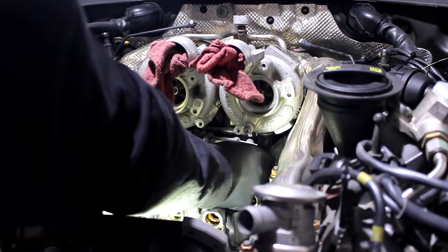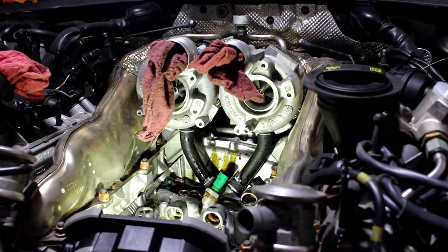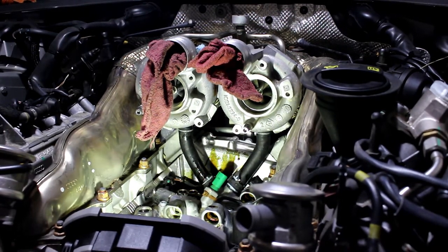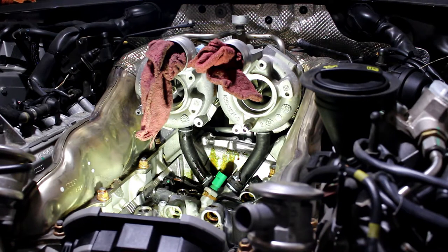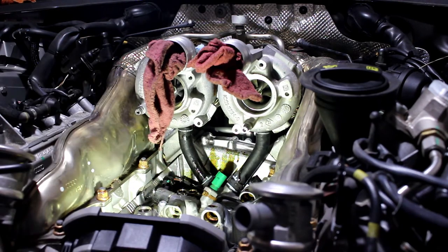The next step is to get up here and disconnect these lines. One of the things to check at this point is the health of these — my lines are in really good shape so I'm not going to replace them, but I do need to disconnect them from the turbos. In true Audi fashion the clips are on the difficult side to get to — two for one and a little more accessible on the other side. I'm also trying to resist taking out that sending unit, but I have a feeling I'm going to need to.